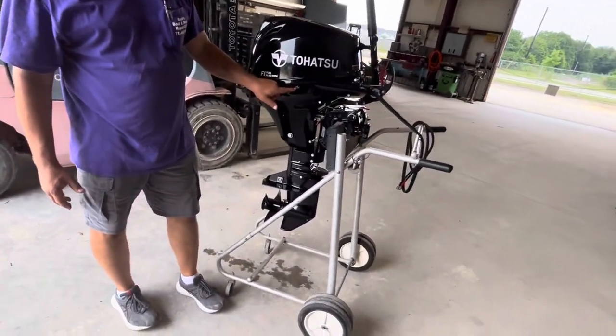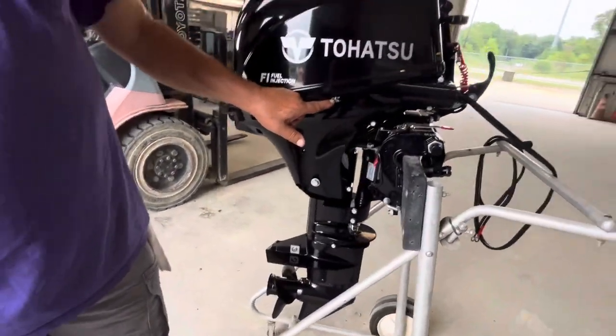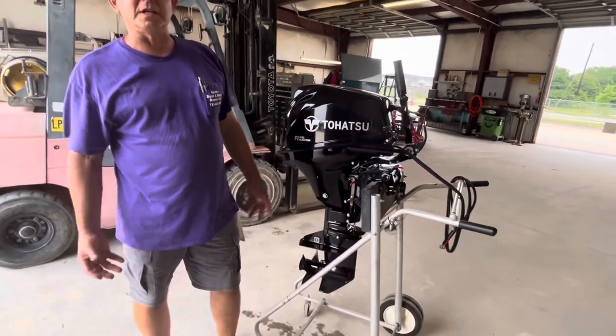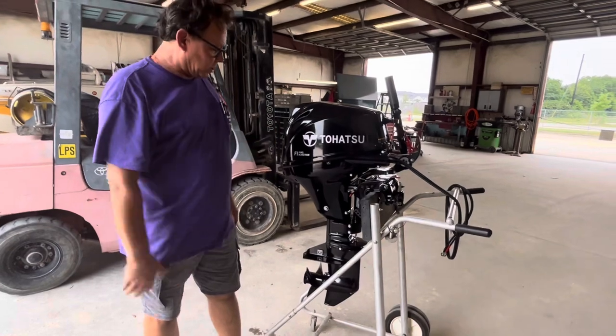There's the handle on the ground, there's the motor. Basically, the more tilt there is to it, the less likelihood that oil will seep out or into one of the cylinders.